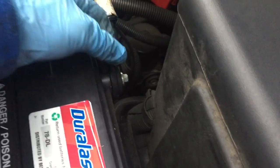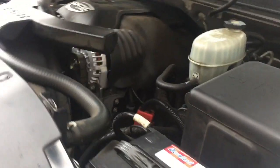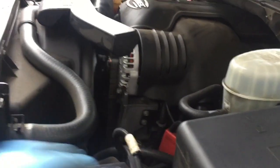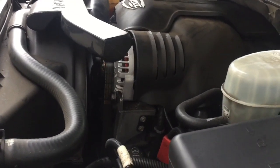Once you have your plenums installed, go ahead and reconnect your battery. Connect your positive cable first, and then finish with your negative terminal. The car alarm could go off at this point — the lights came on automatically. Now we will go ahead and fire it up, and then I will retest the alternator and the battery to see what kind of voltage I'm getting.